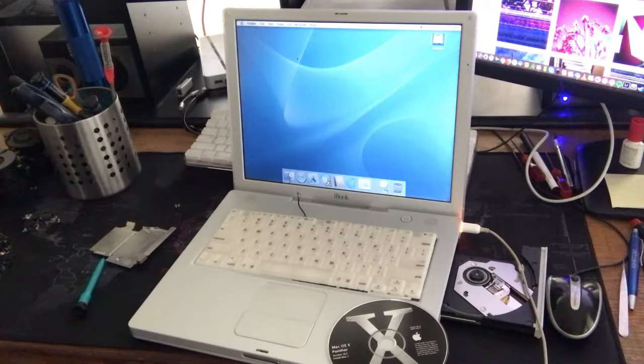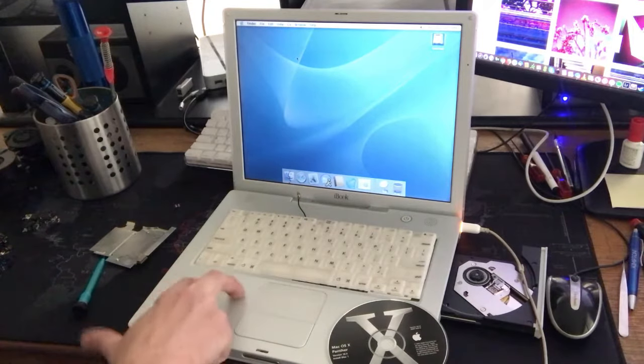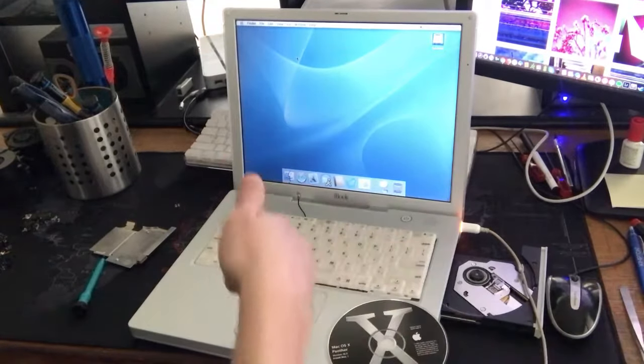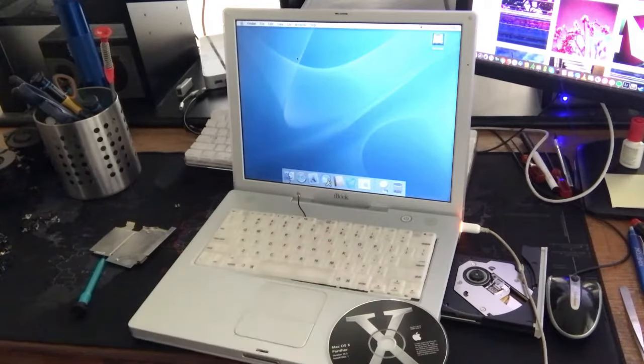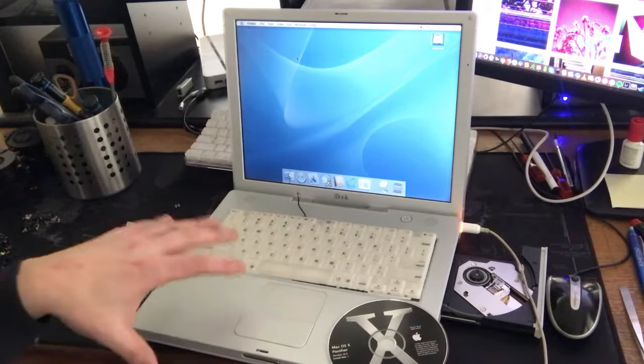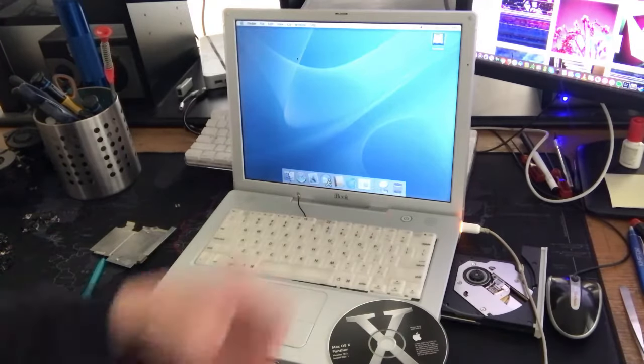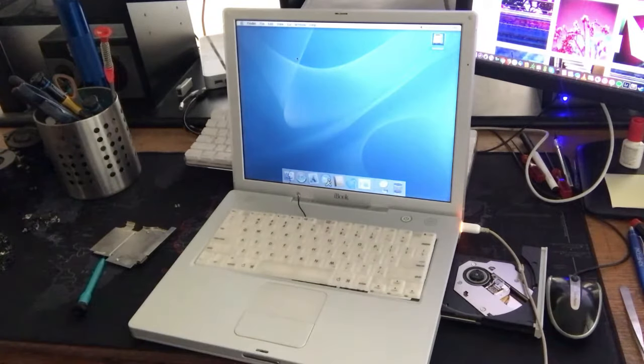And with that situation, what you need to do is go to my website, poweronpads.com. Again, poweronpads.com. If you can't power on a laptop with a power button, it shows you where to find the power on pads, which are these two little metal pads that you can trigger with tweezers on the underside of the board, and that will jump the machine so that you can test whether the board is good in a situation where you can't power on with the power button. So anyway, long way around that topic, but yeah, very nice that it has a distinct power button there.